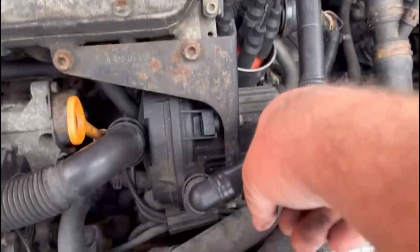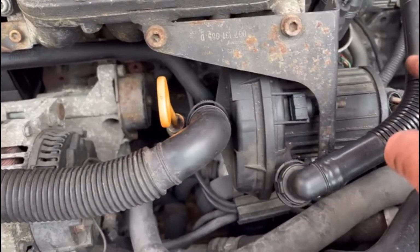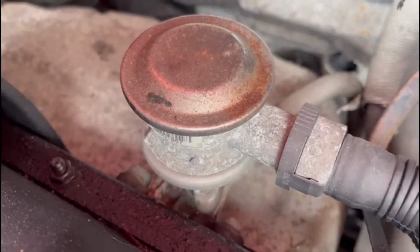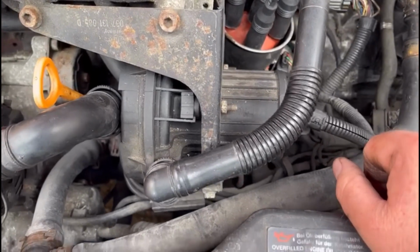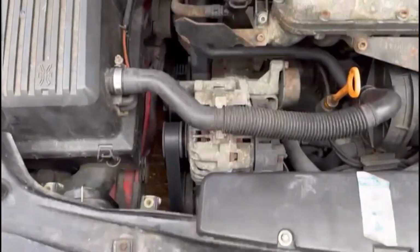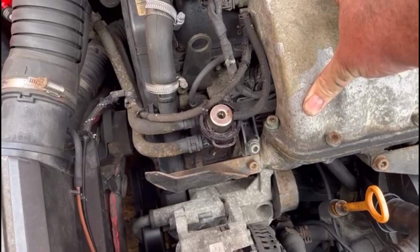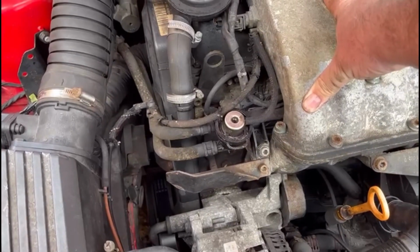So basically this secondary air pump takes clean air from the air box, sucks it through this pump, down through this thing, and then through the exhaust to heat the car up quicker. And these pumps are on for probably 5-10 minutes this time of year where it's still quite cold. But I'm going to change these vacuum lines now. I bought some snazzy new red vacuum line, as you'll see. It might not make any difference, but it certainly can't hurt.